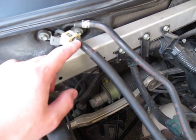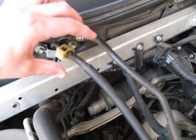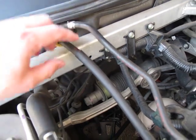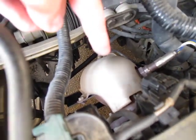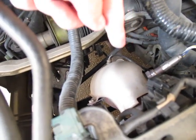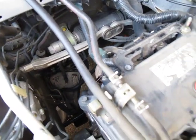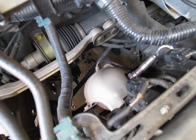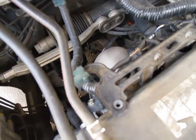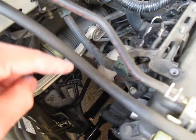I'm going to run a copper or steel fuel line. First I'm going to go to a pressure regulator to reduce the pressure down to 1 psi. Then I'm going to run that fuel line around the exhaust system - maybe around the catalytic converter, round and round, many feet, all the way down. I need to get that fuel real hot. From what I've read, my catalytic converter gets to about 350 to 400 degrees.